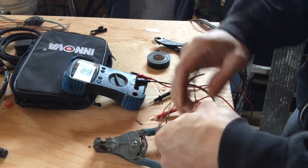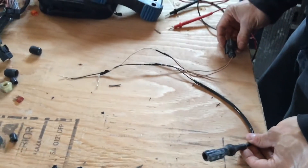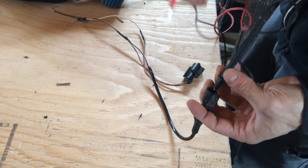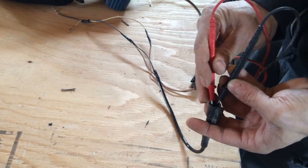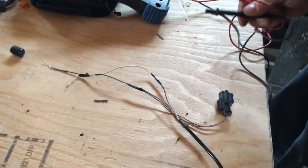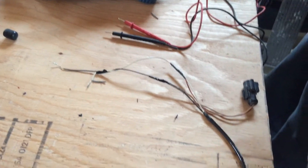Give them a little twist so they don't fray too much. It's an easy way of setting up a little tester for ABS. The only reason I did it like this is because trying to probe into these little pins they always seem to want to touch each other — it's very hard to hold them in place and get a good read. By having these plugs it's awesome: you just shove them in and you've got an easy way of putting things to the continuity test. Do your tests and see if they work; if not, change them out.